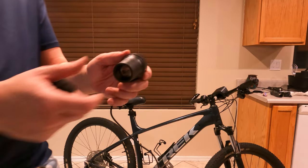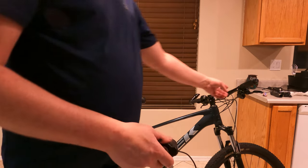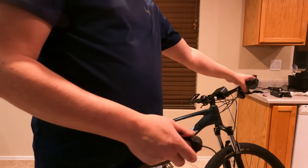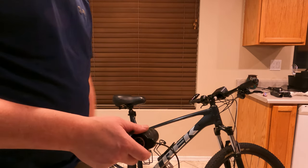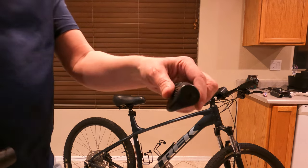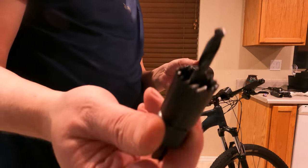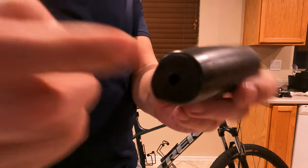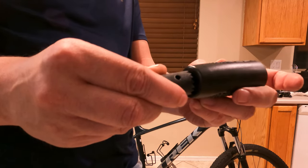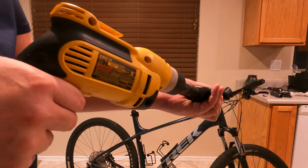I've got a replacement half-twist throttle that's a little better. I decided to put it on the left side since I didn't have enough clearance on the right and didn't want gear shifting and throttle on the same side. The ones I found didn't have an open bar end, so I used a hole saw the size of the handlebars to create a starting point, then just drilled it out as steady as I could.